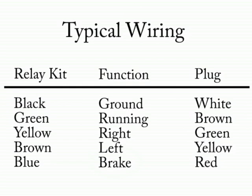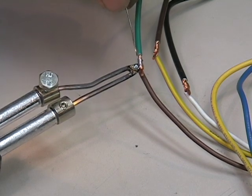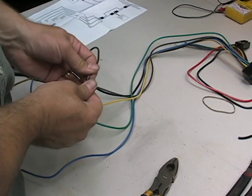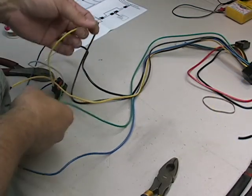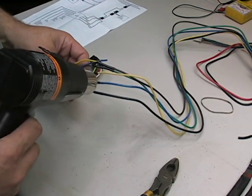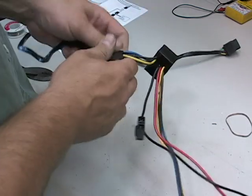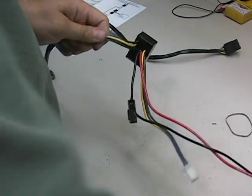If you have a used trailer, you might need to take a 12-volt source like a battery, hook it up to the trailer, and try the lights to see which color drives which lights. For the most durability and reliability, I'm going to solder the wires together, cover each joint with a piece of shrink tubing, heat that shrink tube to cover the connection, and then wrap everything tightly with high quality vinyl tape. Now that's a clean harness — all ready to be installed.